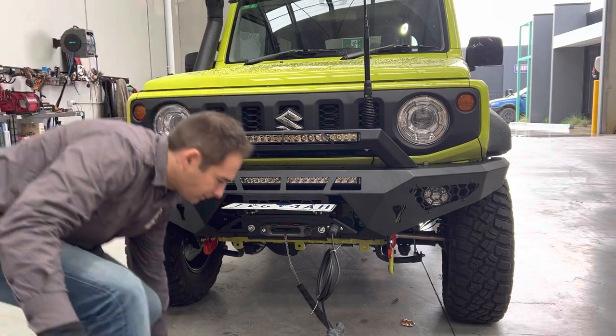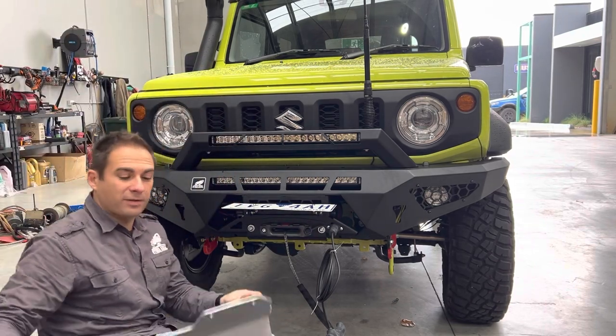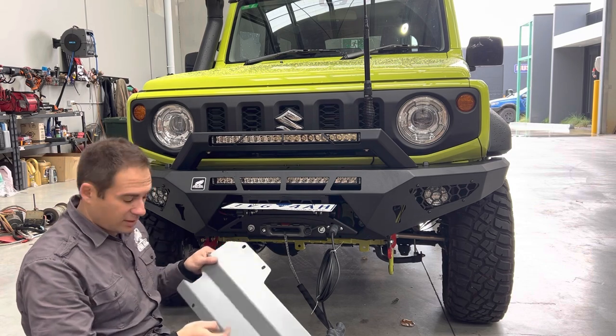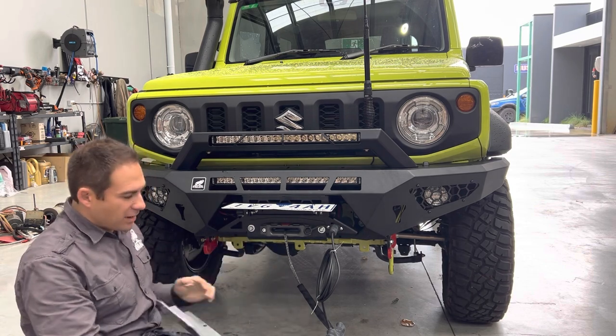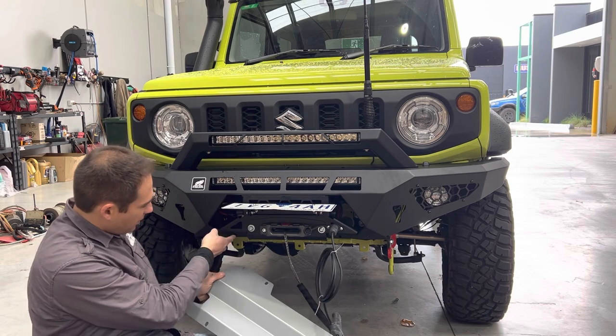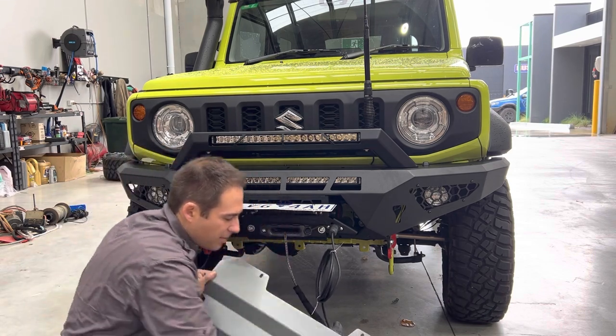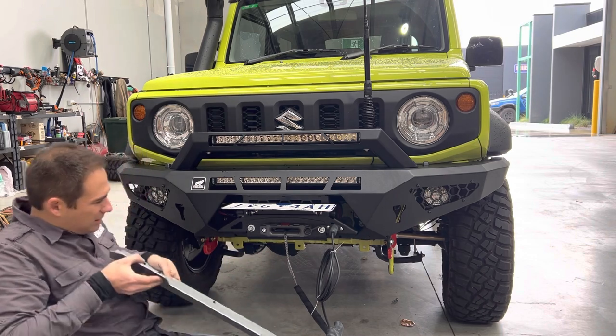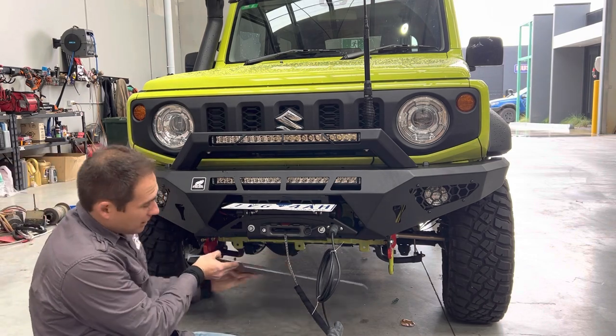Time for the bash plate. It has four bolts in the front and three underneath. M8x20 to the front — there are threaded inserts in the bar — and the same on the bottom with threaded inserts. Basically hold it in place and get the bolts in.